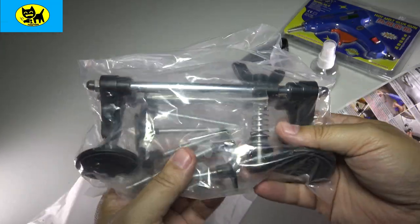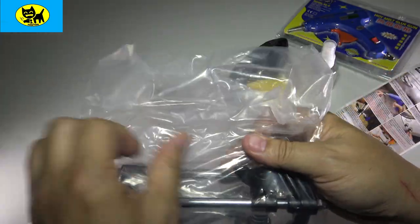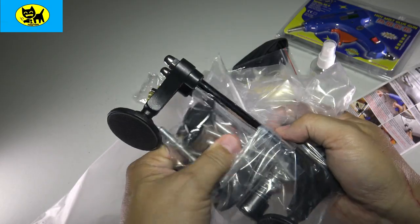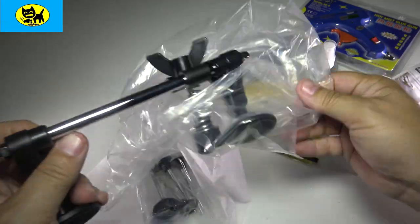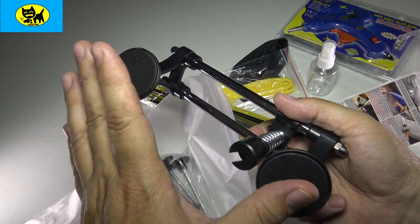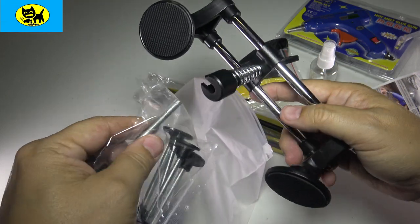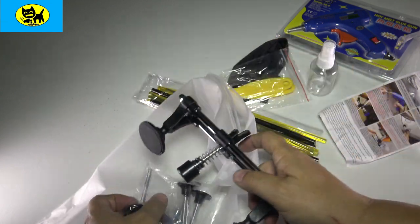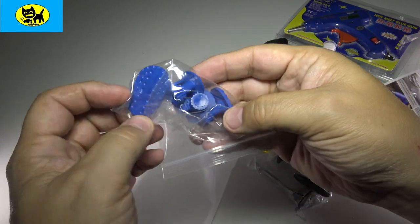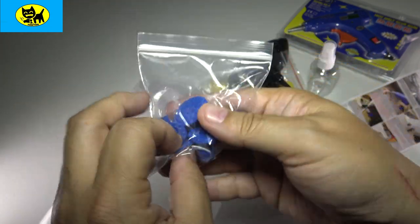This is the actual tool itself — the puller. It comes with some different little screw-on attachments. The actual pulling mechanism is spring-based. This is a nice quality item — not super cheap plastic, but nice and durable plastic. On the bottom there are some nice rubbery bases so it won't slide and won't damage your car. You stick in one of the attachments and this sucks that little ding right out of your car. There are lots of different end attachments with little dots to keep the glue in place, and different sizes for different types of dings.